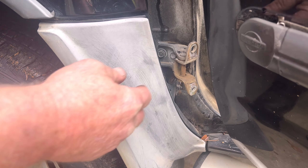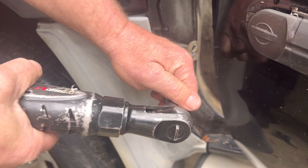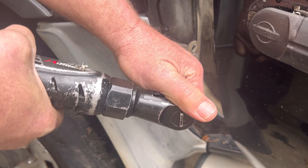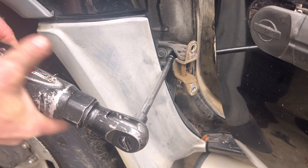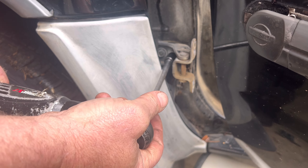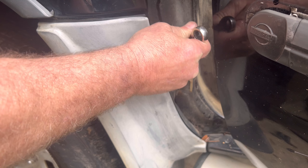I don't have a swivel to get on that one. I may have to put a little leverage on that edge of the fender to remove the inner part of the fender just a little bit to get to this bolt here — if I do, I do — because I do not have a swivel here. So let me grab my tools. Let's see if I'm going to be able to get on to it. It does not appear so. Maybe I would have got a wrench and socket on it — let's get this one out to start with. Let's see if I can get it with a wrench if it ain't too tight.